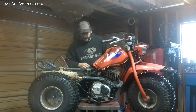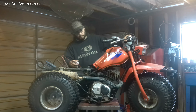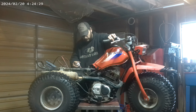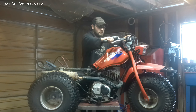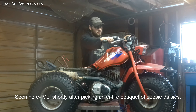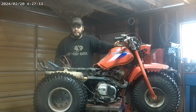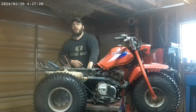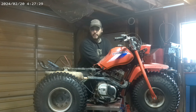Okay, and I guess that's what it needed. I would like it if I could get it running off of the gas that I put in the tank now — it's already on reserve, so it should start. Ultimately, I'm not going to put into the video all the time I've spent trying to start it. It really only wants to start if I have my hand kind of manually choking it on and off. And even when it does start, it doesn't want to stay running by any means. So I'm sure I have to get into the carburetor, which I should have expected anyways because it's been sitting for so long.